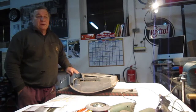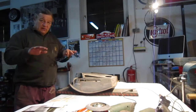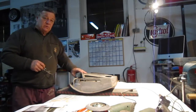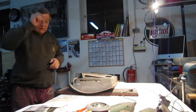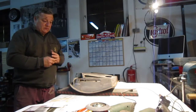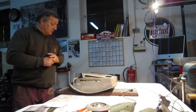You might think, why am I doing the door skins now? The problem is because of the journey that the car was on — the floor and the box section have been in such bad condition that the car has kind of twisted slightly and it's leaning back. So I need to check with the doors that I've got the rear bulkhead and the front bulkhead in the correct position, and this is the reason I'm doing the doors now. Also, I can't put the door skins on until the actual frame of the door is sandblasted and painted. Amir is back on Friday and will start work Saturday morning.